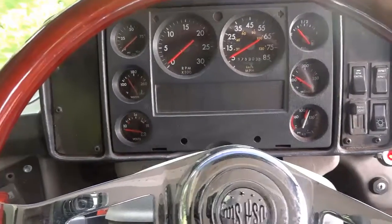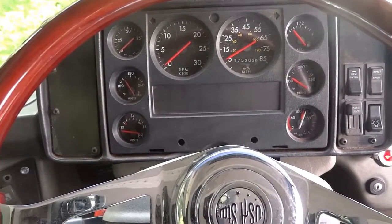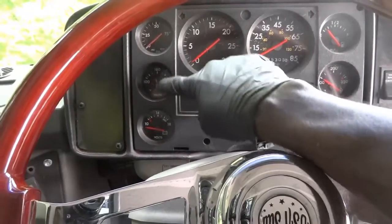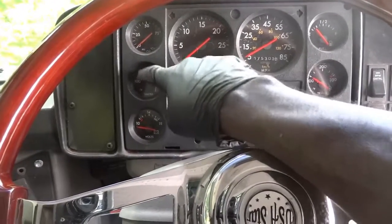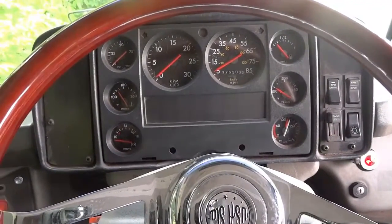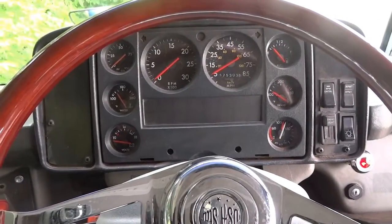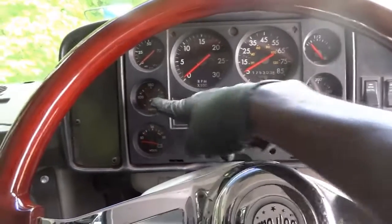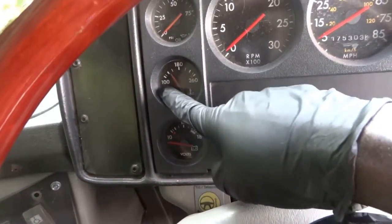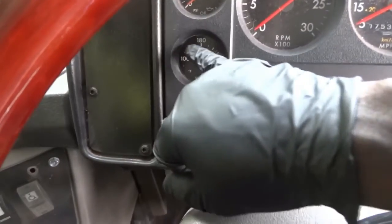Let's talk about this. Right off the bat, I'm thinking we either have an engine temperature sensor fault, a wiring issue, or the cluster gauge itself is defective. I've seen this cluster go bad and report an inaccurate reading. I think this is going to be a quick one. Let's go under the hood and unplug the engine coolant temperature sensor. Once we unplug the sensor, this gauge should read zero — basically down at 100 degrees Fahrenheit with the sensor unplugged.